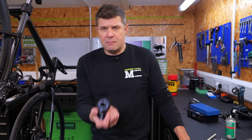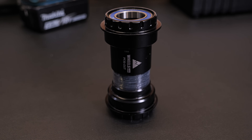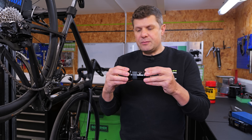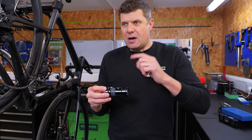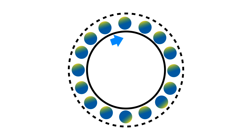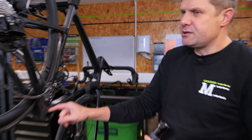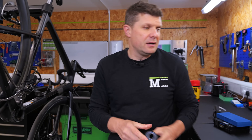Probably the solution you'll find in most bike shops would be one of these — a thread-together bottom bracket where you have two pieces and essentially just clamp onto the frame. I'm not a massive fan of these because I still think they need a fairly tight fit to stop them moving, and a gap this big I think we're still going to get some rock. Also, the threads are oriented so that if things go rusty, they'll start to undo themselves — because our pedaling direction combined with bearing precession means the rotating force on the outer side is actually backwards. I don't think there's enough holding force here, and though you could get away with it using thread locker, for me these just don't work that well.